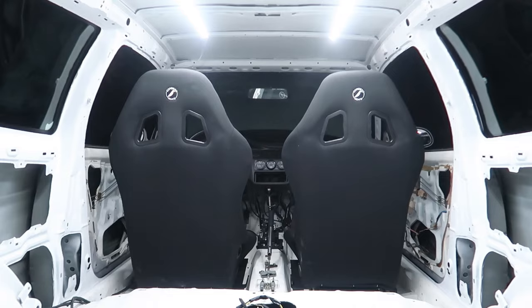No lights... spaceship. It looks literally like something out of NASA or SpaceX inside the car. It's just some cheap Amazon parts — 12-volt LED strip with aluminum channel and diffuser strips. You can buy them all on Amazon. It's not a bolt-in kit, it's a DIY setup. You have to make your own switch, be decent with soldering, and watch the bends or you'll rip the pads off the strip. But I think it came out freaking sick — let me know what you think in the comments.